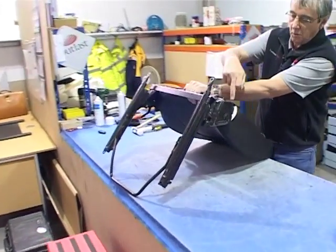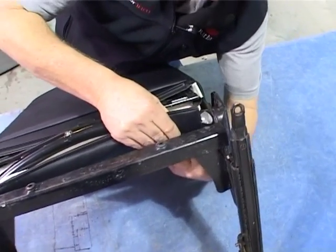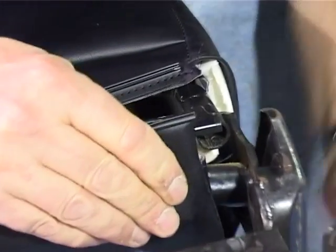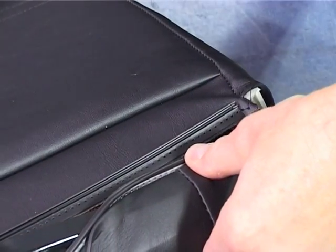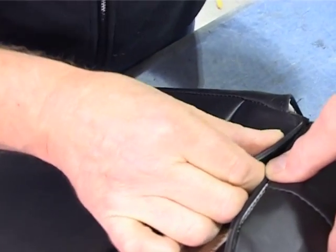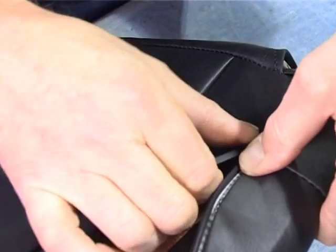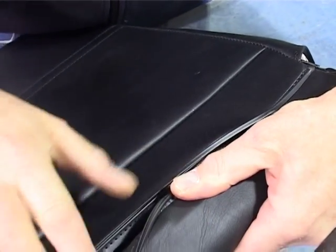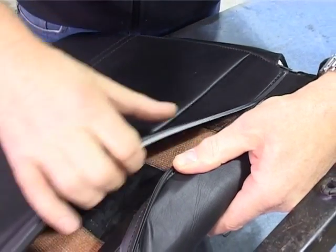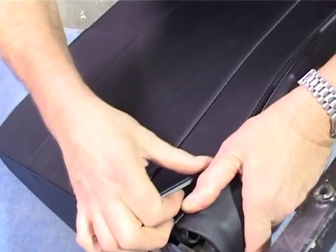And we're now going to join the two beads together. So tuck your fly under, just so it's level with this stitch line here. Hold over and pin with your thumb. What we do, start at the end. It's a little bit fiddly, it's a little bit hard on your fingers. Clip it on. Move your hand up, pull it over, supporting it again with your left hand, and just work down slowly clipping. Clip it home.